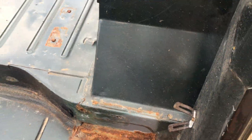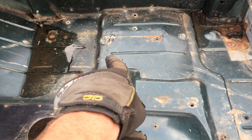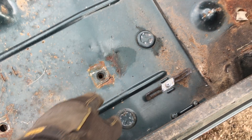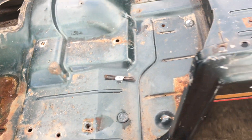Here's that piece — it's just in the corner, so I would get it out of there to minimize it, but other than that I wouldn't do anything. These two seat mounts are cracked, so you'll want to spot-weld those in. This one is starting to do it here too. It's not rust — it's just where they crack. What happens is they get loose, and instead of somebody tightening it like they should, they don't, and that seat starts rocking and eventually literally cracks the metal. You can see it did it real good on this one. These are simple fixes — it's kind of common in them.